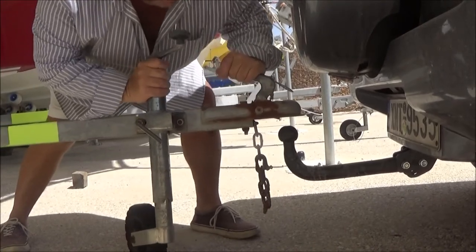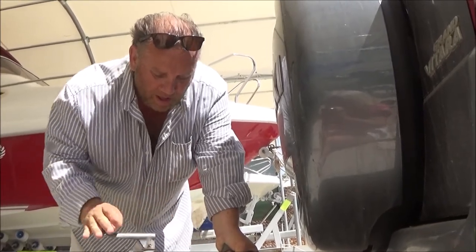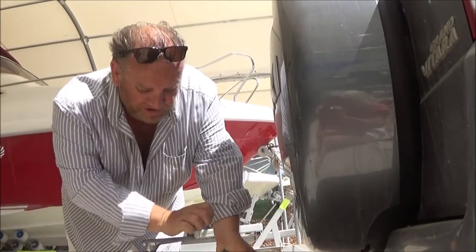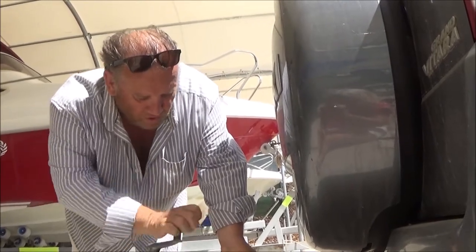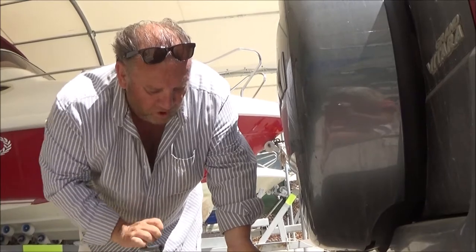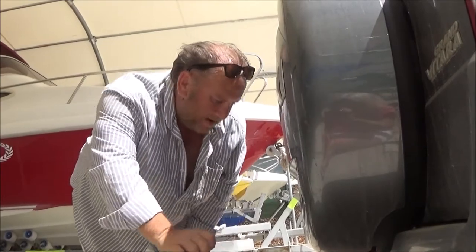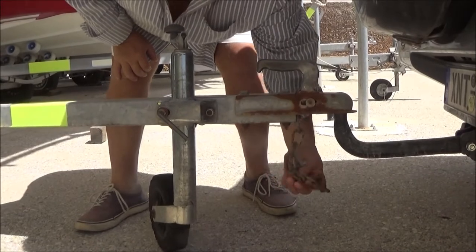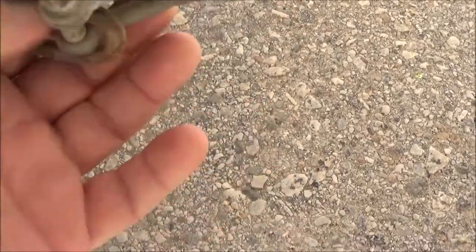That's a little bit too far — okay, now I'm there. I'm gently holding the trailer over the ball and lowering the trailer using the height adjuster. You'll see it in a second — it will lock into place. There we are, we're on! The next thing I'm going to do is put this chain on — there's the bracket holding that chain into place.